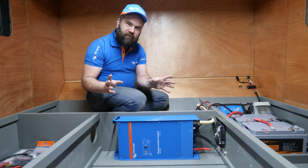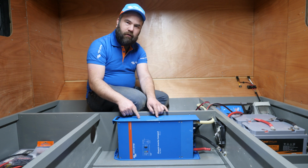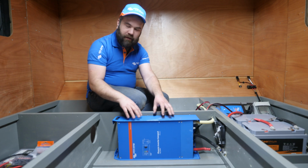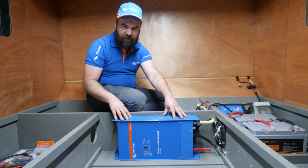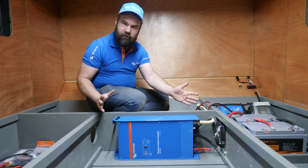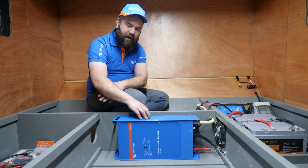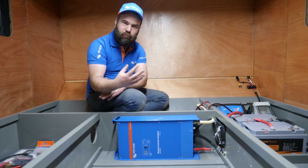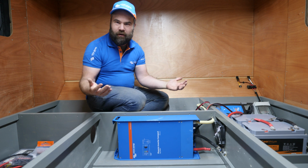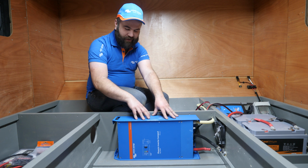I asked a Victron installer in the Netherlands. He installed 150 inverters and Multiplus units, and he only has 3 back for repairs. And he told me that it's fine to put it like this. It's not the recommended way, but with the extra cooling it will not die and it just runs. And if it overheats, it won't break, it just throttles down the output. So instead of 1600 watt, it will become like 1200 watt, something like that. It's hard to kill this inverter, so I will be fine like this.